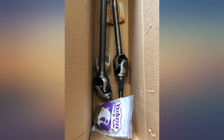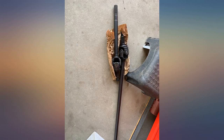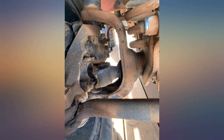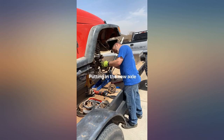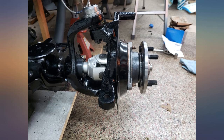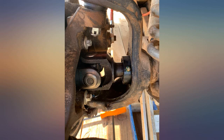After breaking the factory Dana 30 axles I wanted more dependable and strong off-road axles. After finding these on Amazon I reached out to the actual supplier, Quick Performance Racing — they were extremely helpful and answered all of our questions. I like the fact that they were already assembled; they have the Spicer U joints and even have the full circle clips, not the half moon clips. Be sure you order these from Quick Performance Racing as they are a Yukon authorized dealer. Price was very good, quality and manufacturing was solid, easy to assemble and install.